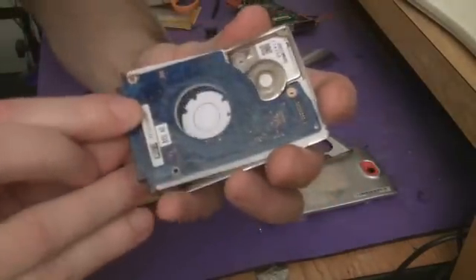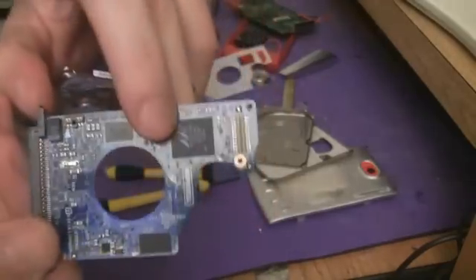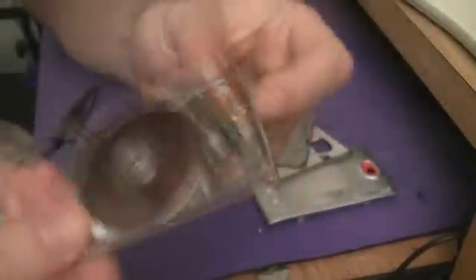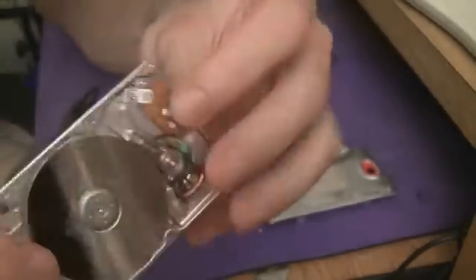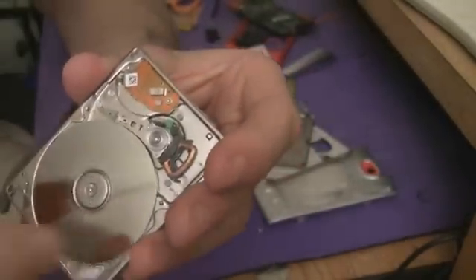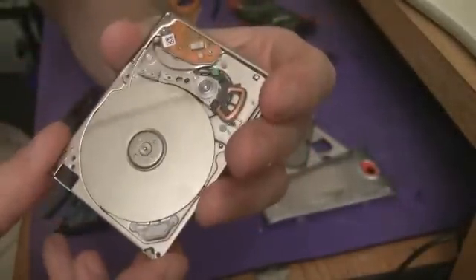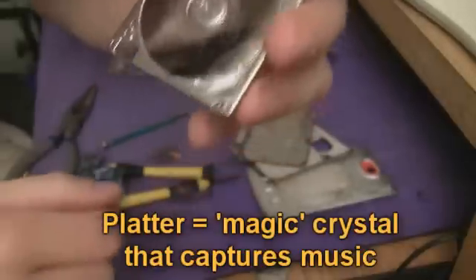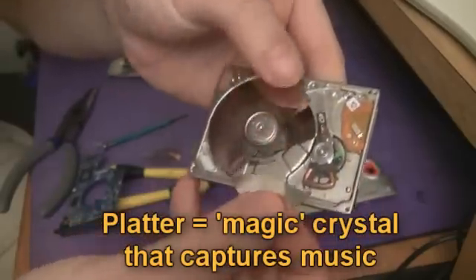So there we go. You've got a little piece of insulator in between the two, and that's your drive electronics. That little thing there, which you're probably going to see, is the connectors — they're connected to the drive. As you can see, this was a 20 gigabyte hard drive. So the technology on this sort of stuff is fearsome. This actually has really good bearings on it. And also, this is a single platter. But for small hard drives like this, the platters need to be made of glass. So if I actually grab a hold of this, what you should find is the platter breaks — yeah — and the platter's glass-like.